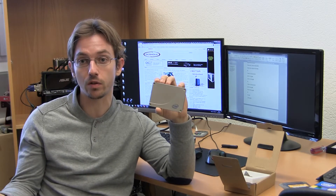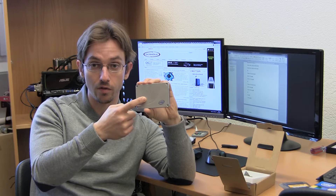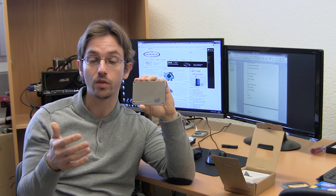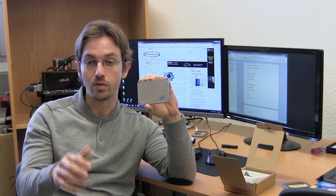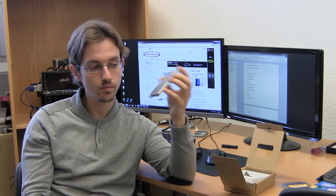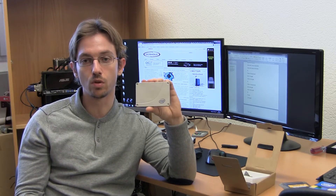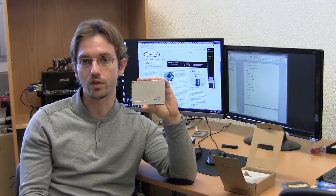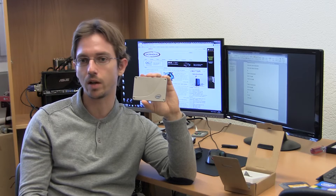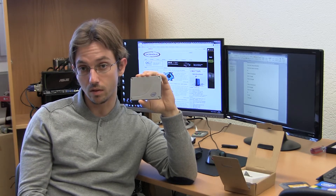You can imagine what kind of power savings you get when you put this drive into a notebook over a 520 series drive. In fact, almost any SSD takes something like between 400, 500, or 600 mW, so this is a very, very energy efficient drive. I've also been looking at the specs online since they're not on the box. Intel promises this drive should be able to perform at 450 MB/s for sequential write and 500 MB/s for sequential read. What I've been measuring is that the performance values are substantially higher.